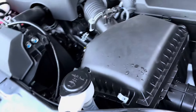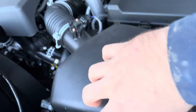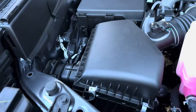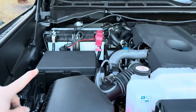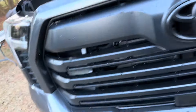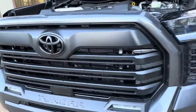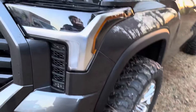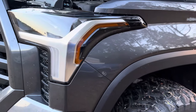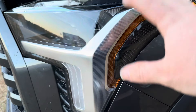What I did yesterday is I basically just took my connector off the airflow sensor, took this clip loose, took the box off, took the filter out, and just pulled the box itself out - because it doesn't bolt down, it just snaps into place. That's going to be the same thing we do over here. As you can see - that beautiful wiring I did on the light bar, look at that, looks professional... just kidding. But yeah, let me get one side out and the bulb in so I can give you guys a comparison on how much better it's going to look.